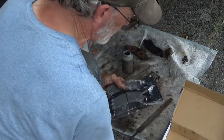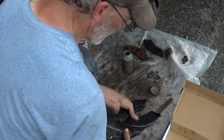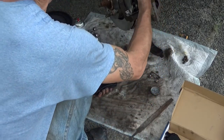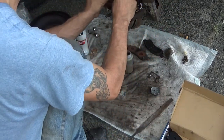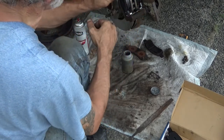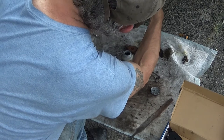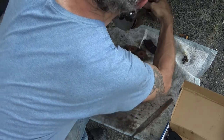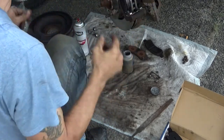Get these brake pads on. Pull all four out. Squealer, no squealer, squealer, no squealer. Squealer goes inboard, leading edge. Inboard, leading edge. Outboard, no squealer. There's a little clip in the edge of these that holds your brake pad in place. All there is to those.